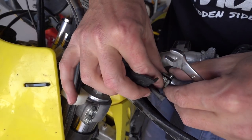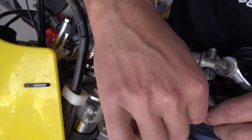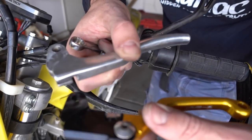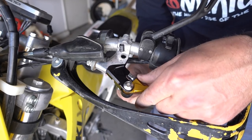Over here, if you align these two little slots, the cable will come through and drop at the bottom of the lever. Now the lever can be removed. With the lever removed, you can install a new one — nice and shiny. Unfortunately, the support bracket for the DRZ is not the prettiest in the world, but it will complement the bike still.